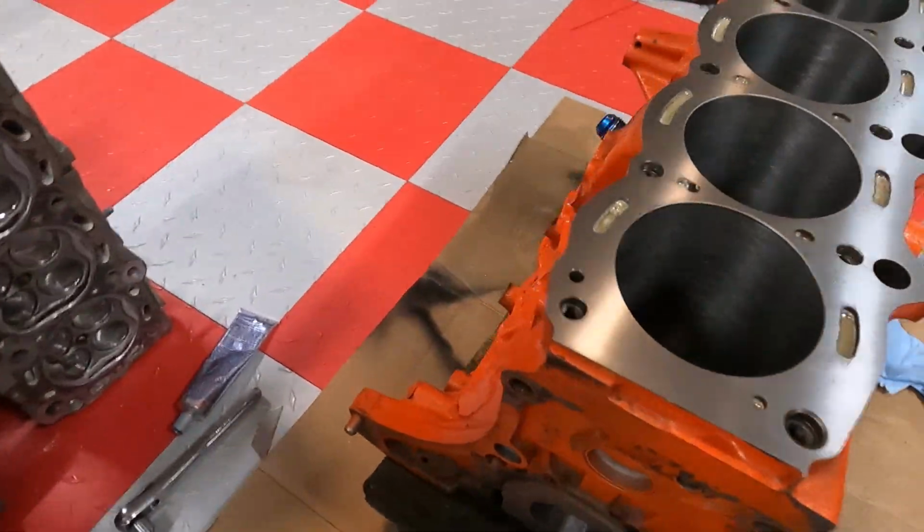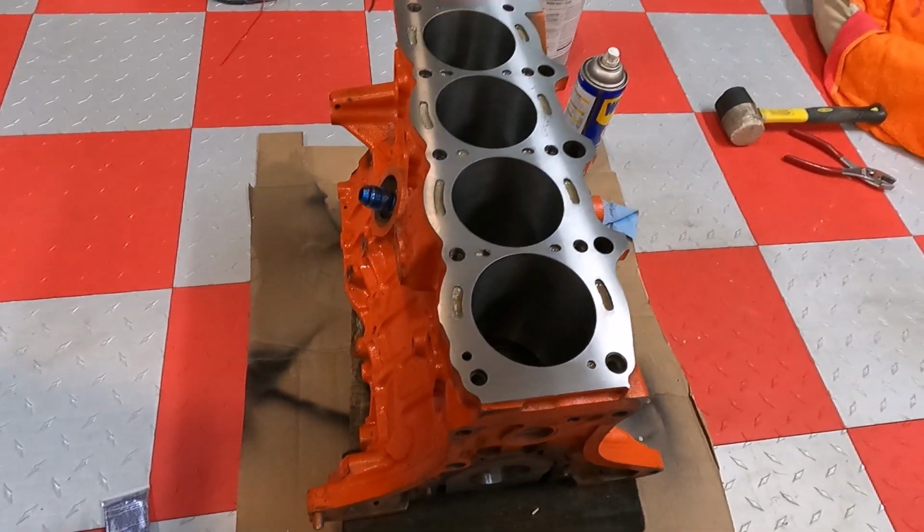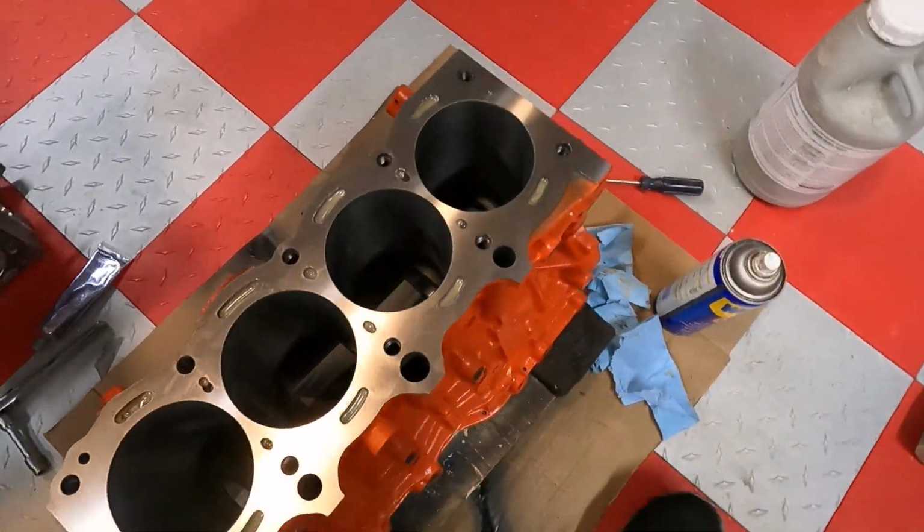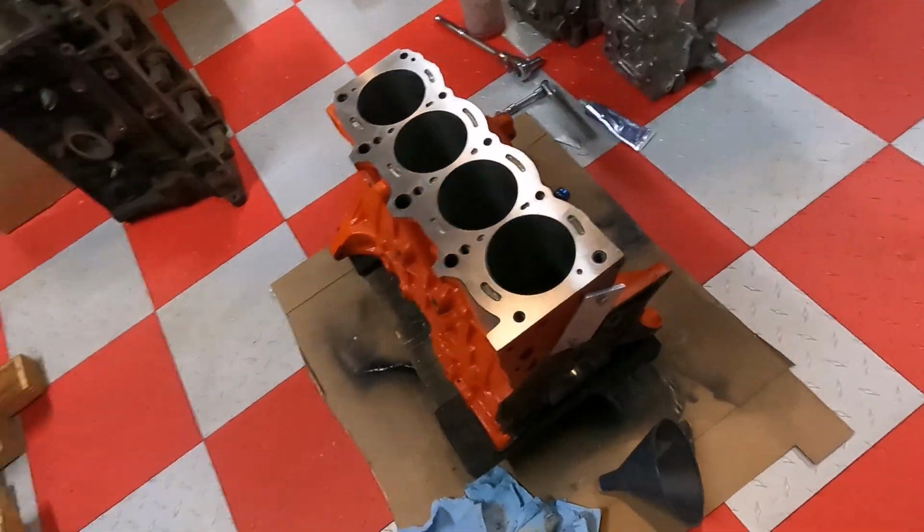And yeah, so this will be a full drag setup for a good customer of ours that's going to go on a Starlet. And it didn't have billet caps before. This is actually our old engine out of our original AE86. So originally when I built that car, it had factory main caps, no cement at all. And again, this was back in 2003. 2000 we started racing this, the AE86, with the 3S motor. And we didn't fill and do any of that. We didn't make the power that we make nowadays, so honestly, it didn't really need it, and the block was strong enough to where it held up, you know.